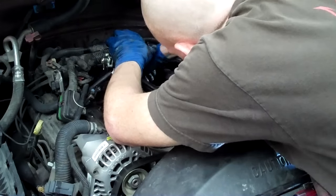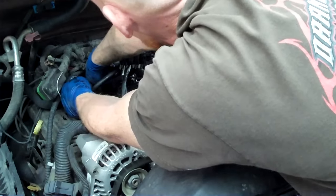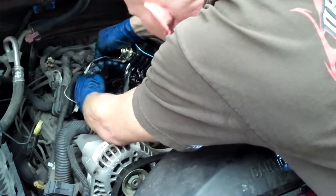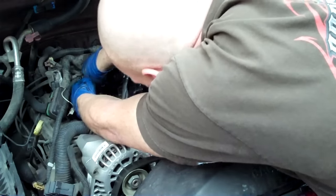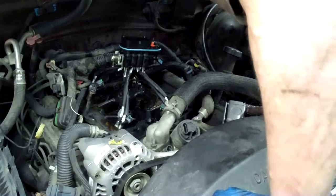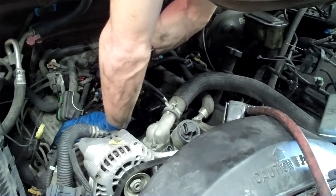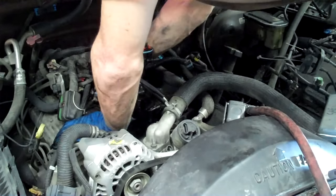So, down in there. I have to think about this a lot every time I do these. Underneath that guy, clear to the end, stick it in. You have to use tubing that is hard enough to take the pressure but still able to bend and be thin enough — it's just one of those paradoxical things. They don't do spider injection anymore; it was such a pain in the butt, they had to redesign it every year. It just got to the point where GM said screw it, let's do normal multi-port fuel injection.